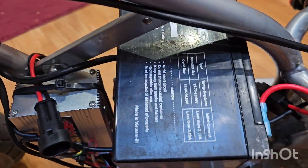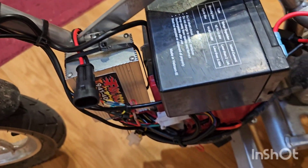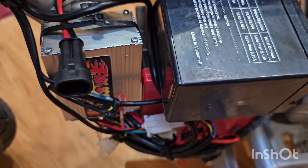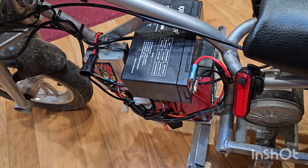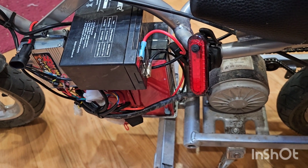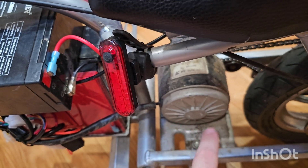This is the controller — huge shout-out to Fast Scooters. They build these in their garage. There's a number on there if you have a problem, and I'll link it in the description — it's from a guy on eBay who has a whole list of plug-and-play items. He sells what he calls an overvolt kit. These motors are run on 24 volts but they're always dumbed down. These motors can actually hold 36 volts — he said up to 38 volts.